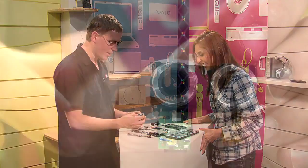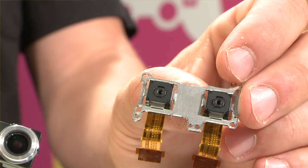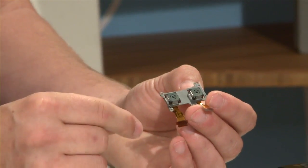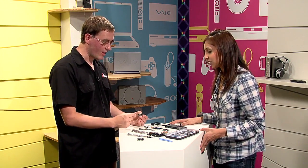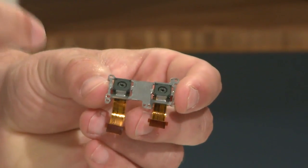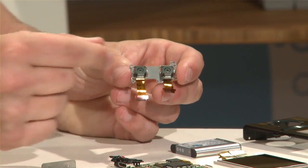The 3D effect is created by rather small cameras. You look at this and you think this is the camera — check this out, I'm going to take the cover off, and you can see these are actually the cameras underneath. These are two 5-megapixel cameras. The Bloggy can shoot 5-megapixel still photos, or when you switch to 3D mode, it combines the image of the two cameras. That doesn't mean you get 10 megapixels — it means it's interlacing the images together to create a 1080p 3D video image. You have to have two separate cameras to give you two separate vantage points, just like your eyes are spaced apart. The distance between the cameras is very particular — when manufacturing these they measure down to a fraction of a millimeter, glue it together so it can't budge, and then calibrate each device off the assembly line separately. It could cause headaches if the 3D image isn't perfectly constructed.